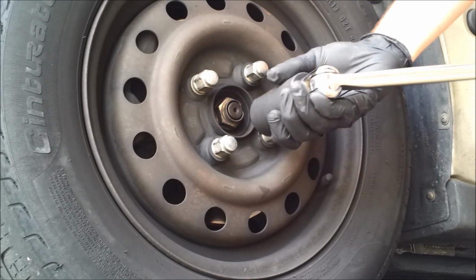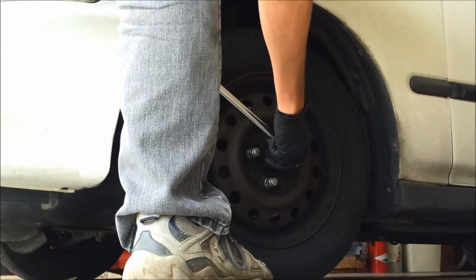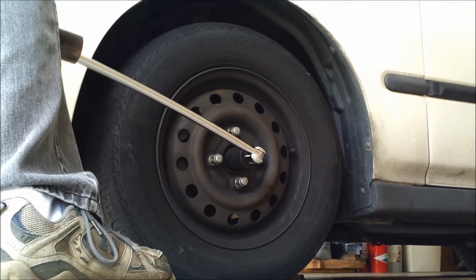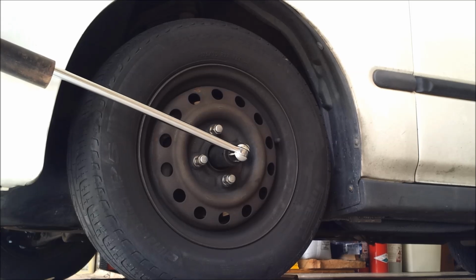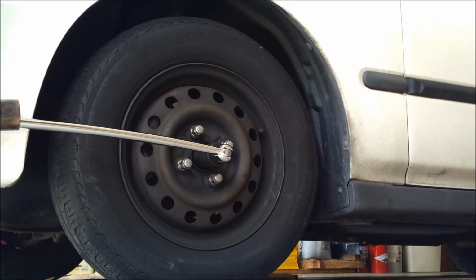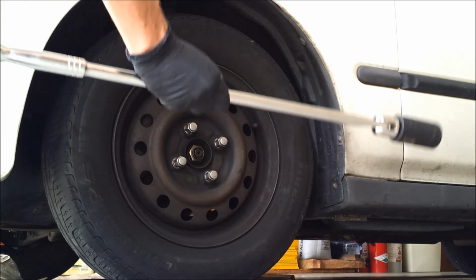32mm. Since the axle nut is staked down to the spline shaft of the axle, I needed some serious leverage. So I picked up a 25-inch, half-inch drive breaker bar and a 32mm impact socket. I'm also incorporating some scrap steel pipe as a cheater bar for extra leverage. Only after standing and bouncing on the end of the cheater bar with all of my body weight does the nut finally break free.